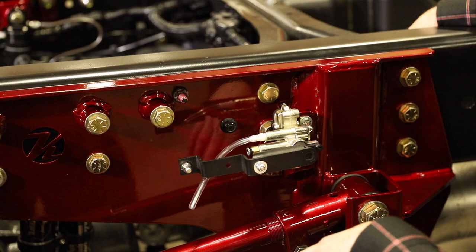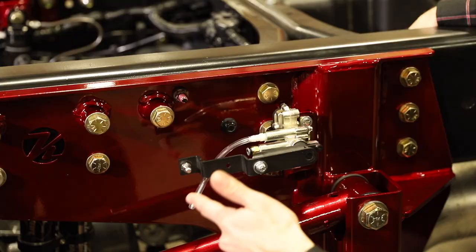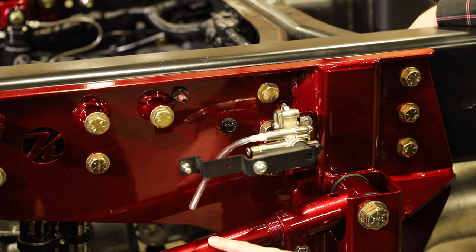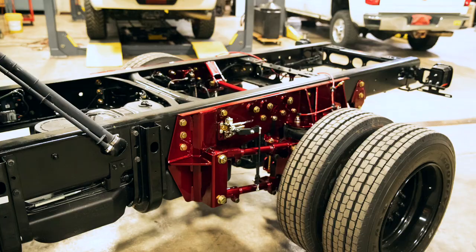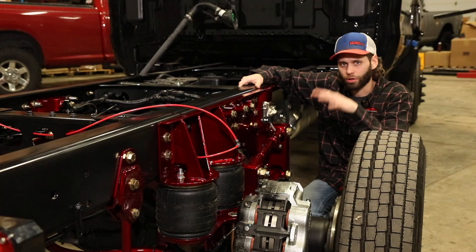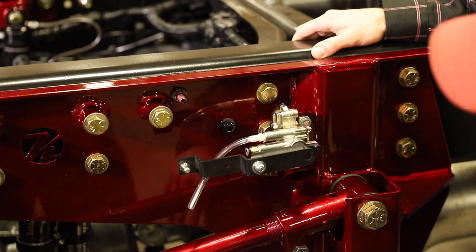You can see we're actually missing a component here — there are still a couple of small items and minor details that need to be buttoned up. But there will be a connecting rod from this self-leveling valve that connects to the upper four-link arm, so that when there's a load put on the truck, this arm will move with the load and adjust the airflow to the bags so that it's self-leveling. The other nice feature is that you have the dump option, just like an 18-wheeler semi-truck would have. You have a switch in the cab where you can dump the air out of the rear bag to lower the rear end of the truck to help with loading and unloading, or to help hook up to trailers, gooseneck ball, or fifth wheel hitch.